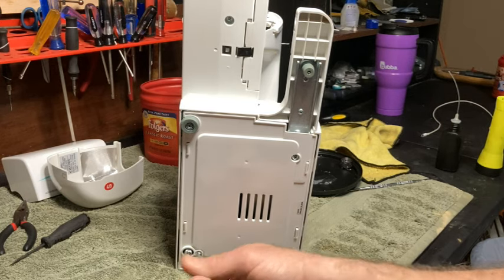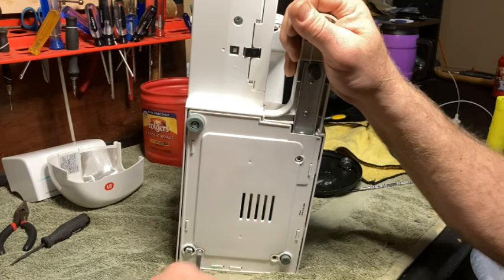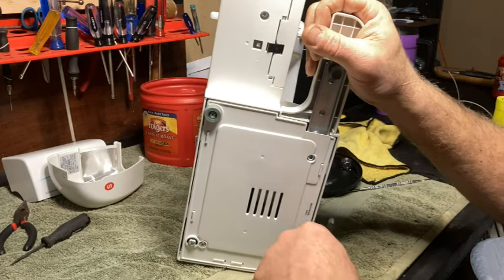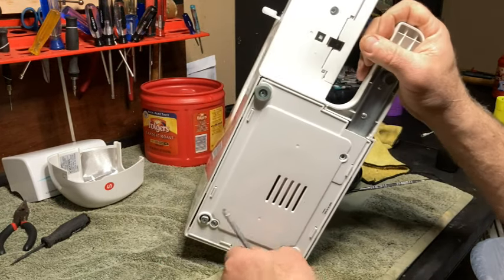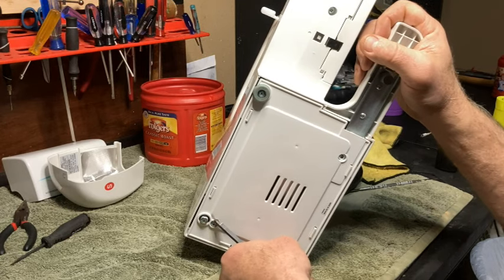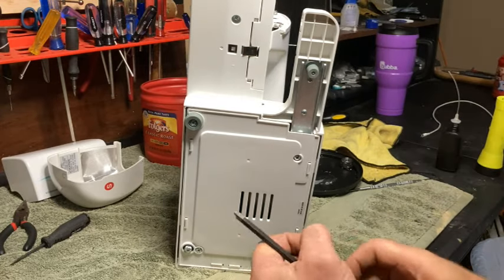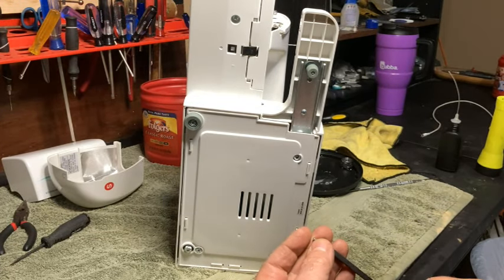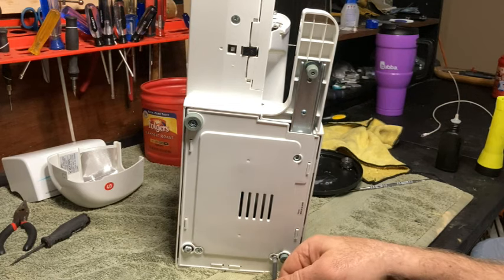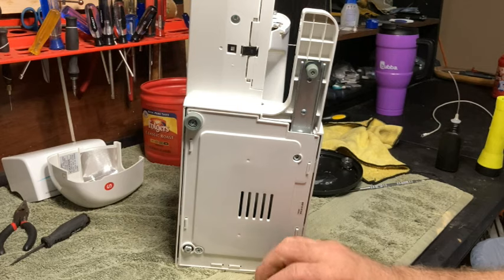Be careful if it prematurely tightens up. That means that you've got it cross-threaded and you need to take it out and get it uncross-threaded. If you cross-thread this and you force it, you're going to tear up the threads and the aluminum in the frame, okay? You won't tear up the threads on the screw because it's a steel alloy screw. But that aluminum frame, you'll tear it up, and then you're going to be up the creek.